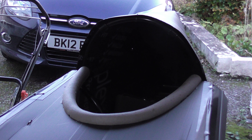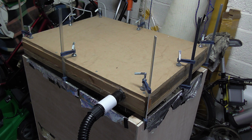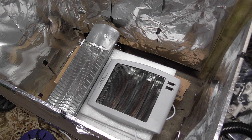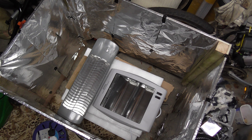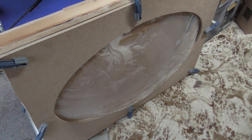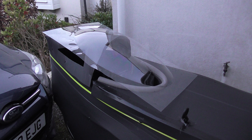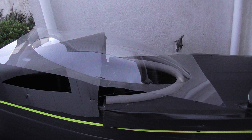To form the new bubble, I made a big plywood box which I lined with foil and put some heaters in the bottom, then placed plastic sheeting on top. The idea was that blowing hot air onto the plastic sheeting would blow a bubble. I used an old vacuum cleaner modified to blow instead of suck — it heated up the plastic and blew air into it. When the plastic came out of the oval cut in the board, it made quite a good bubble. You can then trim it and add it to the top of the velomobile. It's very thin plastic but when formed into a bubble it's actually quite stiff. It did work quite well — quite warm and it kept you dry.